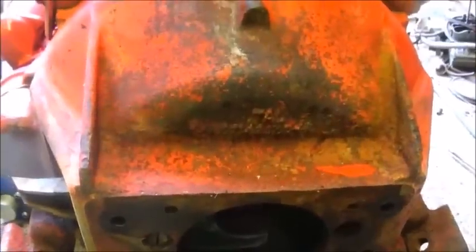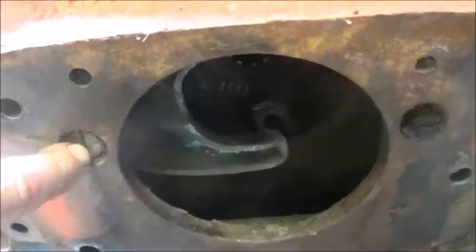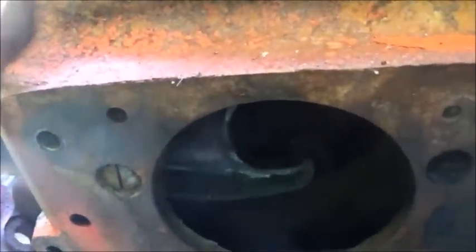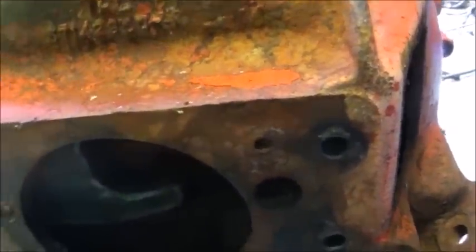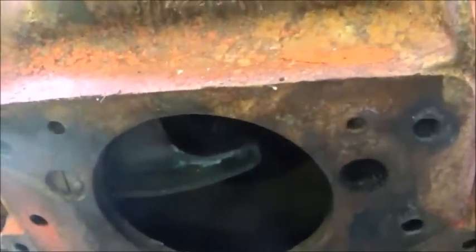On this side is a tapered hole - this is a screw, I think it's a 3/8 coarse thread, but it actually screws into the back of the ball, and the ball is where your clutch fork pivots. There's another hole just like it on the other side. We'll clean everything out, flip that fork over, put the ball on this side, and put her back together.